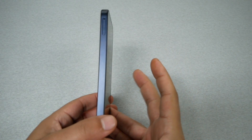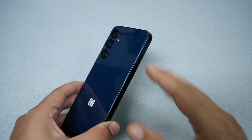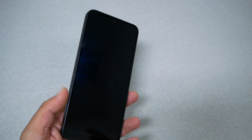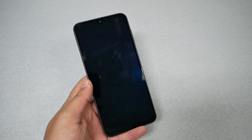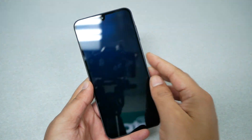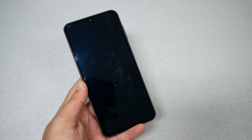What I'm about to do is force restart the device. Because the Samsung Galaxy A16 doesn't have a removable battery — you can remove it but it requires a lot of work, you have to unseal the back. So instead, we're going to do a deep restart by pressing two keys: volume down and the power key, and hold them for around 7 seconds.